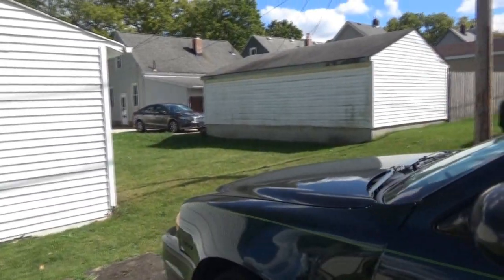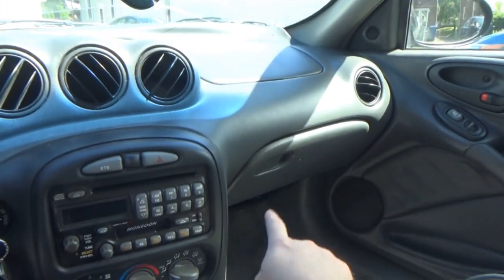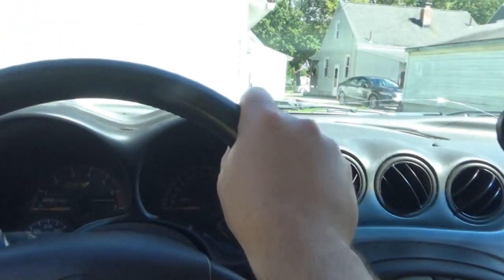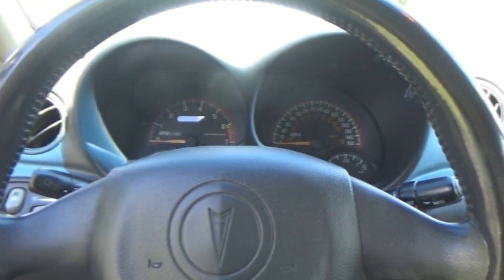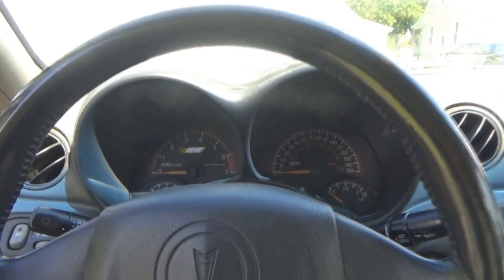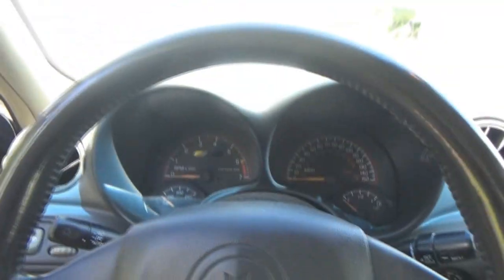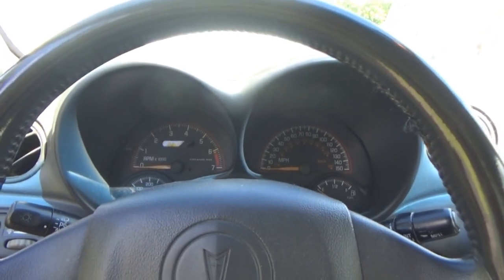And also, we had a weird issue with the power steering fluid. I haven't lost any yet, but I think I found the leak when we had the car up on the rack doing the weld. One of the lines, which is almost against the body under the floor on this side, looks a little wet, so I think that's where our leak for the power steering may be coming from. Haven't really lost any since I filled it up, and I've been driving it quite a bit lately. So we're just gonna play that out as time goes on. Like I said, we've got the Autel here. We're gonna go ahead and plug it in, retrieve some codes, and start this ABS thing from the top.